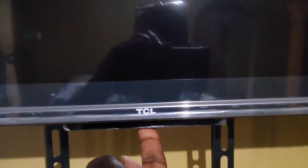Once you unplug the TV from the outlet, go back and locate your power button. In my case, the power button is towards the front center. Simply locate it and press and hold — count to 60, hold for a full minute. Don't worry, the TV is off and you'll need to use the physical button on your TV.